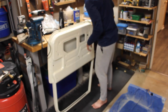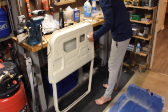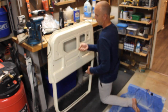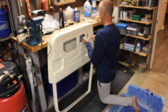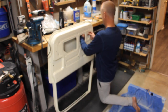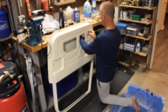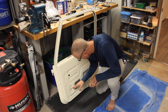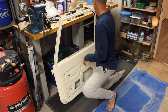Next is the bottom support bracket that the main support channel for the window mounts to. It's a simple folded piece of metal with two welded-in nuts, installed with the original short five-sixteenths screws with serrated grip washers. Make sure the open cavity faces the inner part of the door and the big hole aligns with the inner mounting support hole. These take a fairly large Phillips head screwdriver. Torque doesn't matter much since the serrated washers hold them.